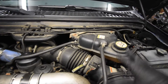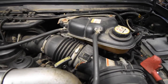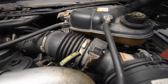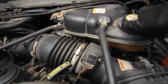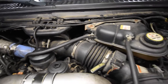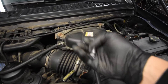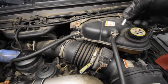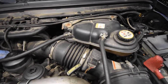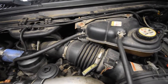To get your FICM out, you're going to need to take the air filter assembly out with the intake tube, and I like to take the boot all the way to the turbo off. Start by relieving the pressure in the cooling system, then put the cap back on — I don't actually drain the cooling system, I just push the bottle over to the side. Take these two hoses off, then use a 3/8 bolt and a rubber cap to seal the degas bottle and hose ends. Gently tip the degas bottle over to the side — be careful not to pull too hard because there's a little plastic Y at the bottom, and if you pull too hard you'll snap that Y off.